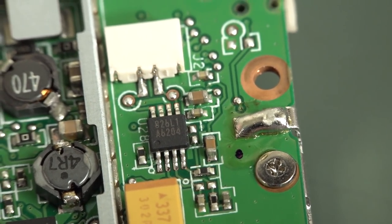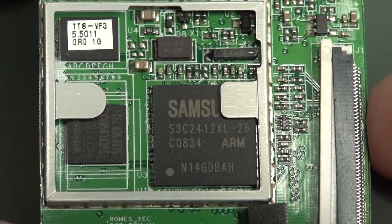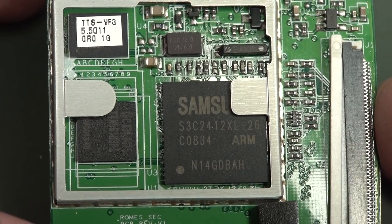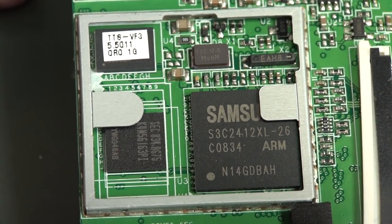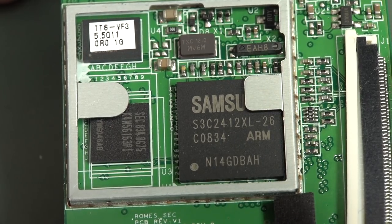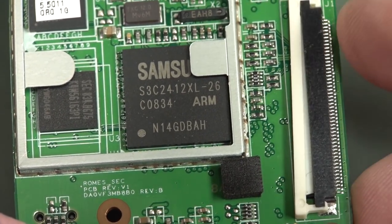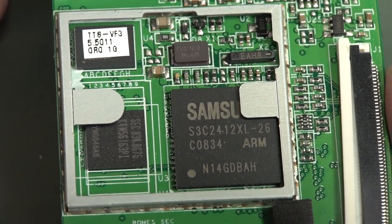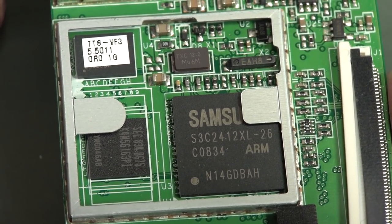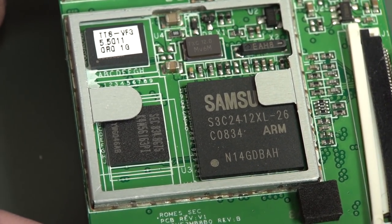It's an Infineon Hammerhead PMB 2520, for those playing along at home. The datasheet's one of those ridiculous NDA things, but Google fixes that. It's just a single-chip GPS solution — it's got the RF front end, RF straight in, then it's got all the correlation engines and all the rest of the GPS goodness, then just data out. There's also a Wolfson audio DAC chipset — you need that for your speaker of course. And the heart of this thing is a Samsung ARM 926 processor, 2004 vintage, specifically designed and targeted to mobile GPS applications — low power, all that sort of jazz.